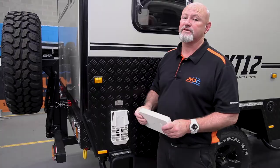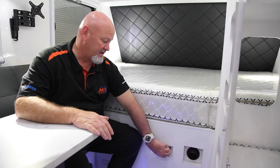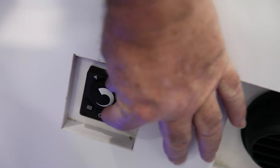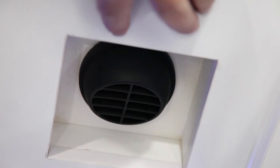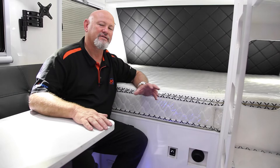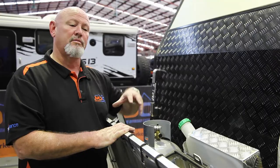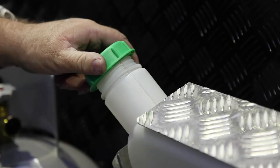In your 16 family you've got a diesel heater. You've got to have it turned on in your electrical department up top, then hit the button and hold on for a couple of seconds. Basically you've got to have it at high for about 3 or 4 minutes, then turn it down to the temperature you'd like and it just keeps the room nice and warm. This is your vent — they come out and warm up the room. It's attached to the diesel heater which is in the external compartment. When you turn it off, turn it off here but do not turn it off at the main switch until it has wound itself down — like a little turbo, it takes about 2 or 3 minutes to wind down. Your diesel tank is at the front. If for some reason you've run out of diesel, do not come out here while it's running and put more diesel in. You have to let it shut down and wind down, then come in, pop more diesel in, go back in and light it again. Please do not fill it up whilst it's running.